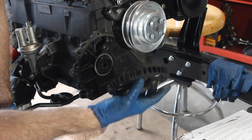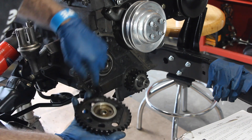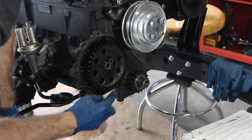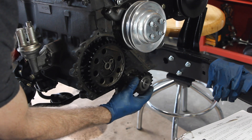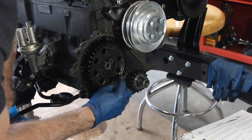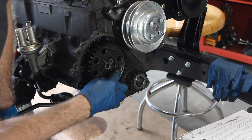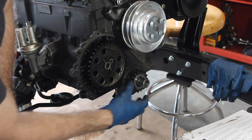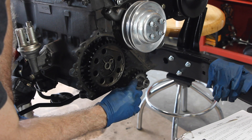They call this a sprocket — how cool is that? There are two points on this. This fits obviously onto your main camshaft only one way. So on your actual crankshaft sprocket, there's a round circle — go ahead and mark that. And then on your camshaft sprocket, mark the one pointer. There's only one; all the other ones are just knobs. You want to rotate your crankshaft to where these two line up exactly.